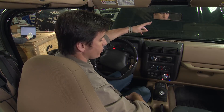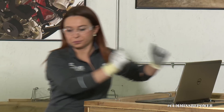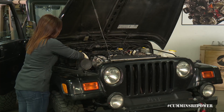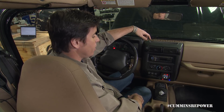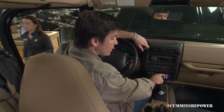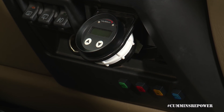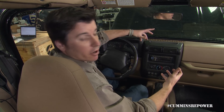So if you've figured out the problem using QuickServe and it's something as basic as a sensor being unplugged, once that condition has been fixed the fault — especially the stop engine lamp — will go away. We might have to key on and key back off a couple of times. After a few different starts, you'll see it goes away. It's not like you have to call a Cummins distributor or dealer if you've fixed the fault and it becomes inactive. I'm going to key the engine off, let the ECM shut down and reset — we know Brittany has plugged back in the MAF sensor.